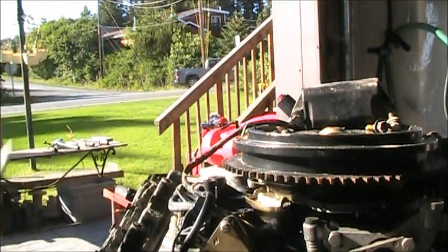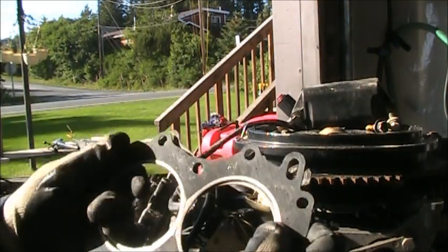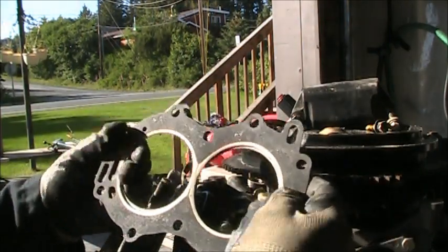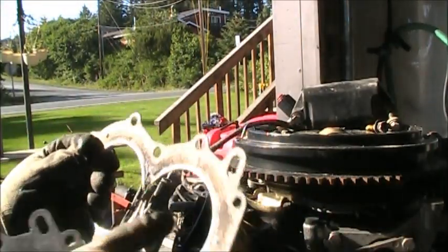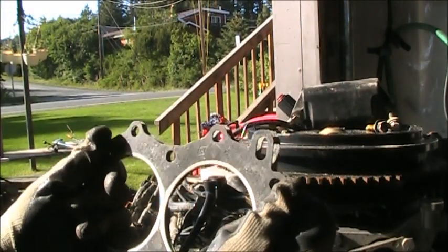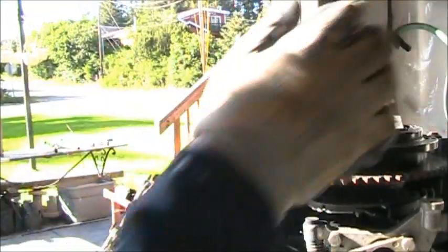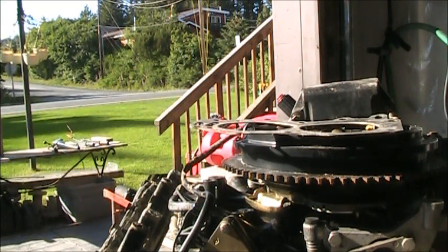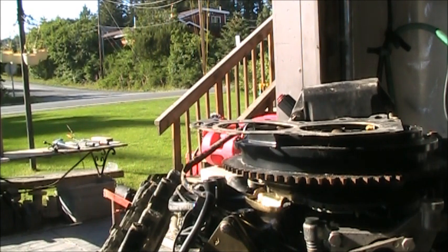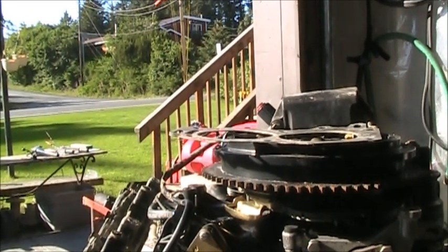And I did. Went through my gasket pile. And there's me the gasket to take place of this roached gasket. So I'm betting we get some compression back. You understand? I speak a little Spanish. Yeah. So I got everything to get her done. So I'm gonna wire wheel this, hit it with a little paint, clean it up, wash it, blah blah blah. I don't think you want to see me wash her head. Do you? I won't make you watch me wash the head. I'll be back.